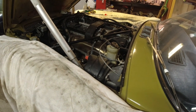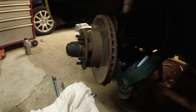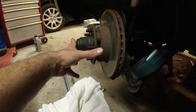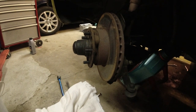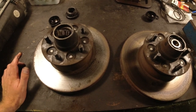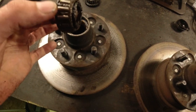I don't want to reassemble the brakes yet because I want those calipers to dry a bit longer. I'll put them out in the sun tomorrow. But I think we're going to tackle the hubs so they're ready when everything goes back on. If you want a detailed video on setting those up, I've already done that. Remove the dust cap, the nut, remove the whole thing, put it on the bench, check those bearings, clean them up, and set them. I pulled both hubs off and I'm very happy I did - bearings look fine, no noise.